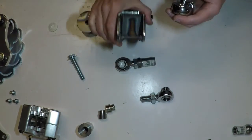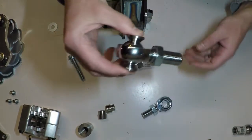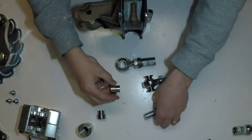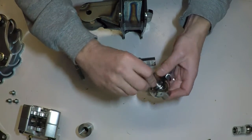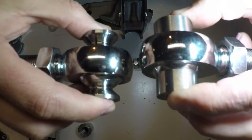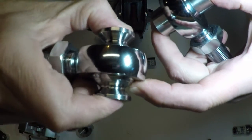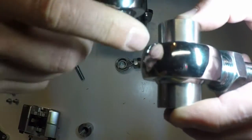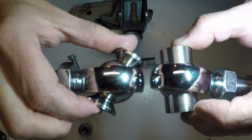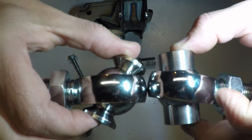However, if you're using it on a spindle which is going to have to steer left and right, you'd use the high misalignment spacers. The high misalignment spacer actually necks in and follows the contour of the heim joint, which lets it angle really far, whereas the straight spacer is just straight. These are both shown at their maximum angle, and you can see the high misalignment spacer goes so much farther.